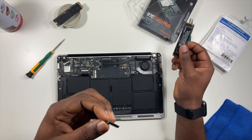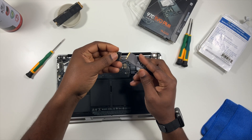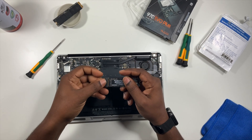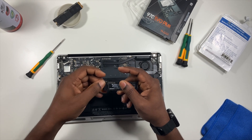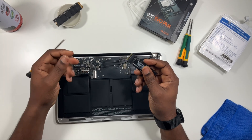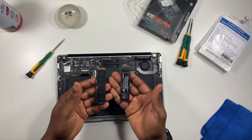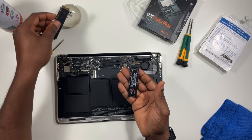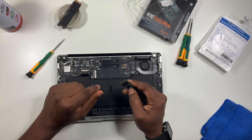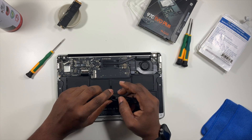Here's the actual adapter — a very small device that converts the M.2 into the Apple format that works with these MacBooks. All you do is grab your M.2 and match up the teeth with the grooves on the adapter — it's in there, bam. Make sure it's seated in there and you're done. You've turned your M.2 into an Apple drive format — very easy, and it really brings some life back into your MacBook Air, especially if you only have 128 gigs like this one.